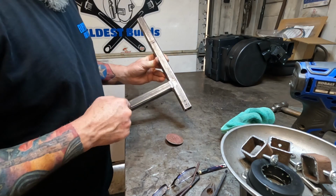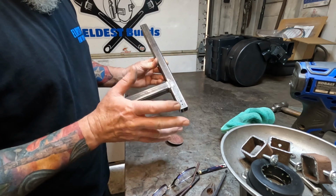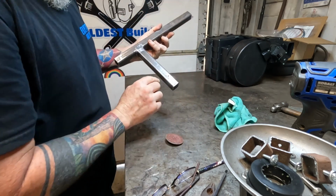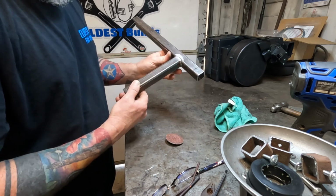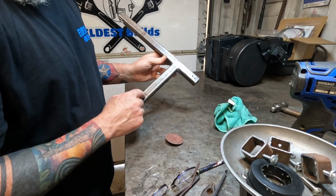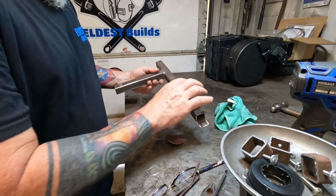So this is the front with all the lines on it. So what I did was I figured out where I wanted my mounting holes in the firewall with my eyeballs mostly. And then I drilled all the way through, and tapped it with that sheet metal screw so I could get it in there. But we're not going to use sheet metal screws. So those are coming out. You can see I did this one. This is for the unit. These are for the firewall. This one was too high. It got into the bead roll on that front. You can't use that because it would smash. So I redid it and we're down here.